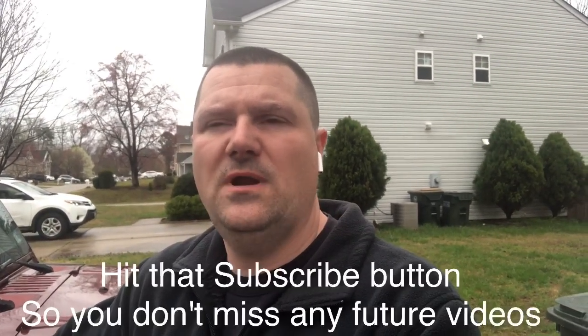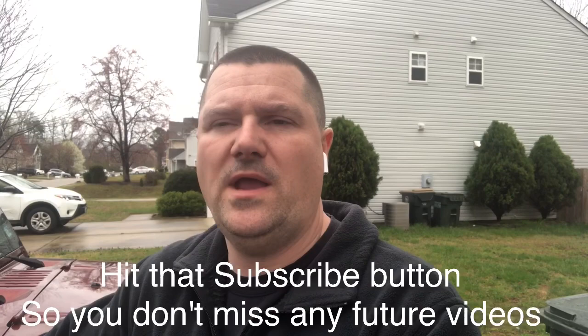Welcome back to JC Motive Garage. The other day I received the Zeus vehicle health monitor and I was scanning the Acura when a P2500 error code came on, which indicates the alternator isn't getting the right current or voltage to the car or the battery. I tried to clear it but it wouldn't clear — it just kept coming back on. So today I'm going to do a review on the vehicle health monitor.